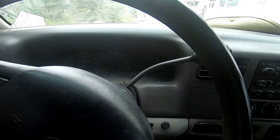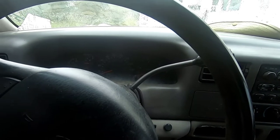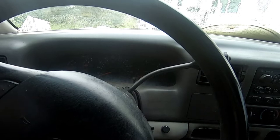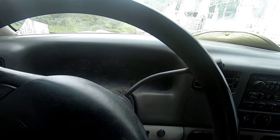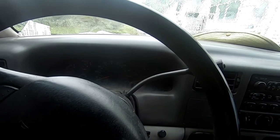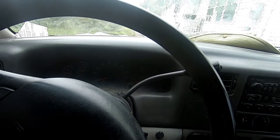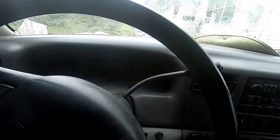One thing this truck did — and I'm going to go into a little bit of detail here so you can self-diagnose your own issues if you're having a similar problem — is when I was running through town at speeds of about 25 to 35 miles an hour, I noticed a dead spot or jerky spot in the pedal. I could accelerate to maybe 25, press on the pedal, and it really wouldn't do anything, and then it would take off and reach 35 miles an hour.